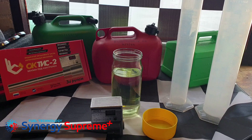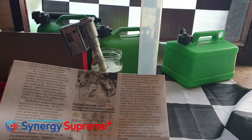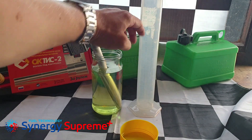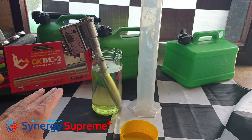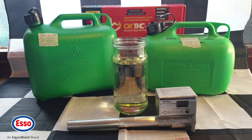I made slight mention of this in the previous octane test video for Sainsbury's fuel. I'm going to be using this jar you see in the middle here, because it better represents the standing tests described in this octane tester's instructions. Previously I was testing fuels in measuring cylinders, and sometimes directly into fuel cans. I wasn't sure if that was affecting the results, so it's just better practice to keep the container consistent across all future octane tests.